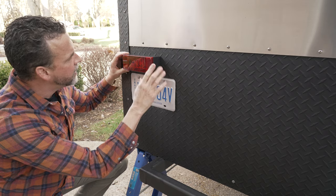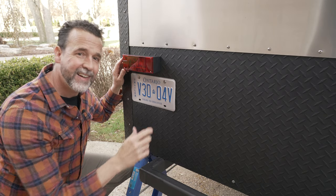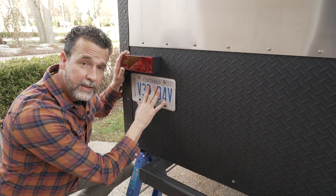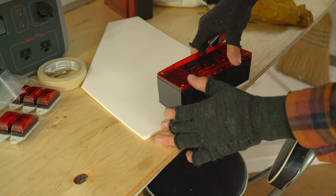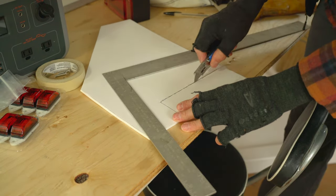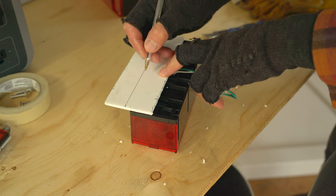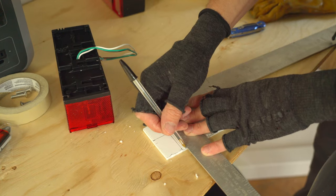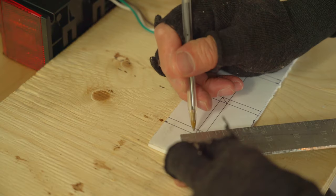These are brake lights that I got from Princess Auto. I bought an extra set to have in case one of these got damaged or broke off, so I would be able to replace them fairly easily. The left brake light also has a white light underneath to illuminate the license plate, which is also required by law here. The brake lights had three holes for bolts to slide into. I was really concerned about cutting into the aluminum and making a mistake, so I decided to make a template using foam board to ensure I had the holes drilled in the proper location.